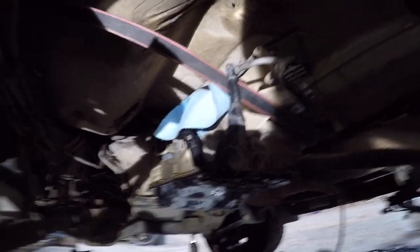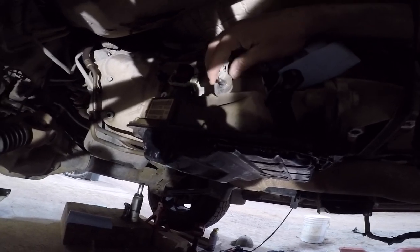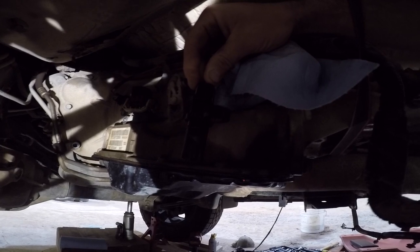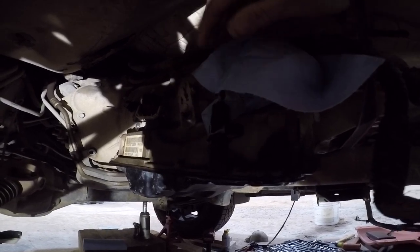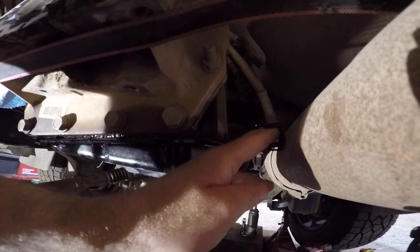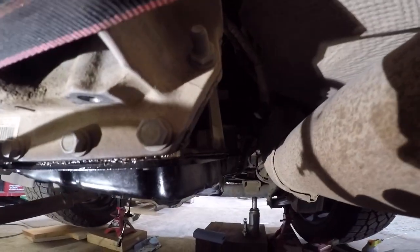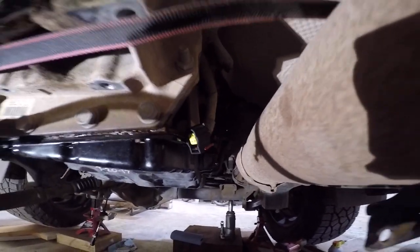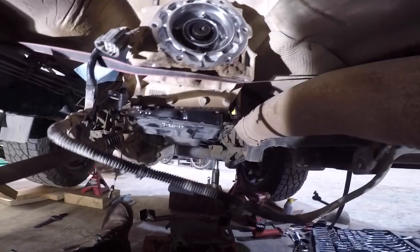We've got all our cables off. We got our shift cable off. I couldn't free this connector, I'll work on it when the transmission's out. But all our connectors are off on that side. This side, we have this connector off. We have these connectors from the top off. And then there is a connector, I think it's your dipstick tube. There's, I think, an 8 or 10 millimeter bolt back there. Just make sure that's free.